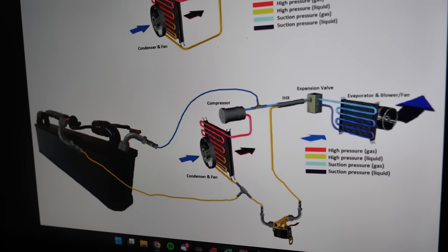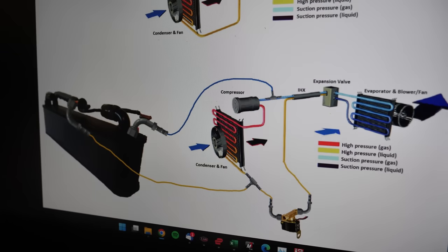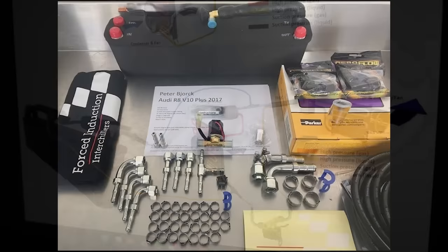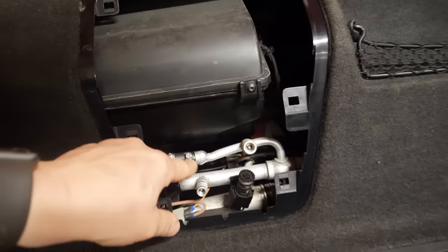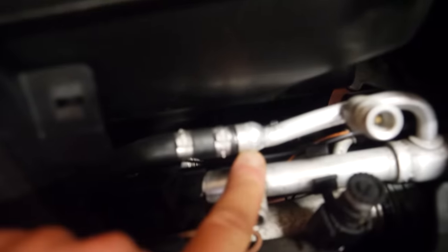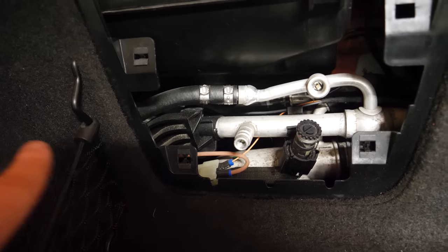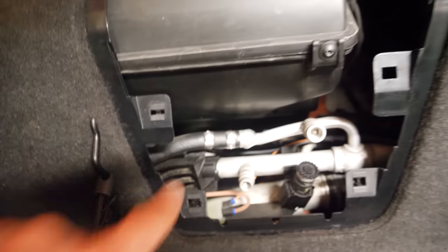In this car the compressor is on the engine in the back of the car, so it was a very short line from the interchiller down to a T. I actually welded an aluminum fitting onto that T and installed it. There are also clamps in the kit so you can run hoses and make your own air conditioning hoses with a special tool — worked really well. Here we can see where I connected the system in the front — I just cut the pipe, welded on one of the fittings included in the kit, and used the clamps on the rubber hose. From this T the interchiller is connected in parallel with the original system, and the condensers are on the side here.